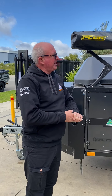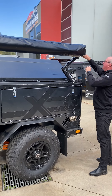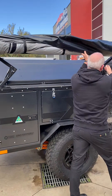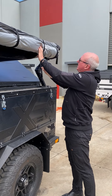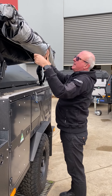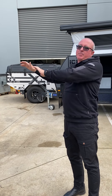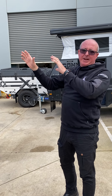Now we have it in the up position. We're going to unzip the bag and open out the awning, making sure you flip the bag up and out of the way. Then undo the three straps and just let the awning hang. The important part here is the first step — always open around to the rear first, and then open around to the front. That's important so that we don't get anything jammed up or hung up.